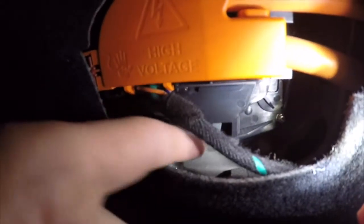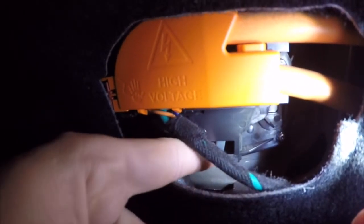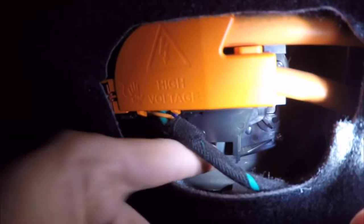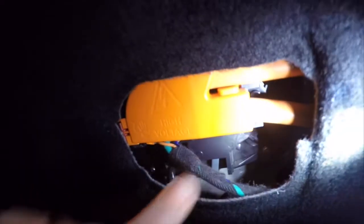Another manual release or emergency release point is found in the trunk — that of the charging port. It's going to be on your driver's side as you open the trunk and it's hidden behind a little panel. You can hear it activating there. It's that very tiny little lever there. All you need to do is pull that towards the front of the vehicle and you'll hear it activate in order to open up the charge port, if it's locked or the cable's stuck, something along those lines. Put your little carpet piece back in and you're all set.